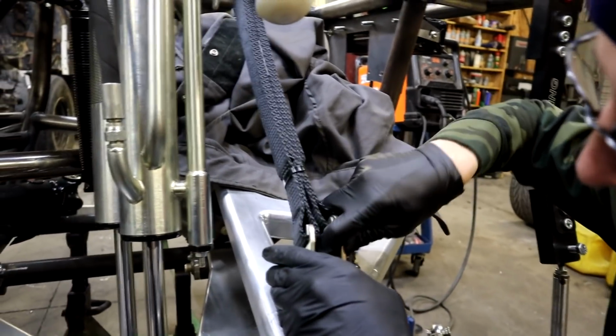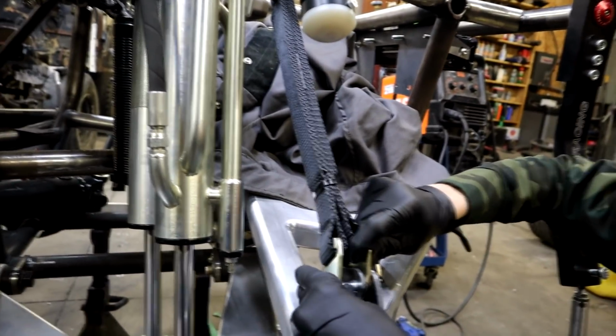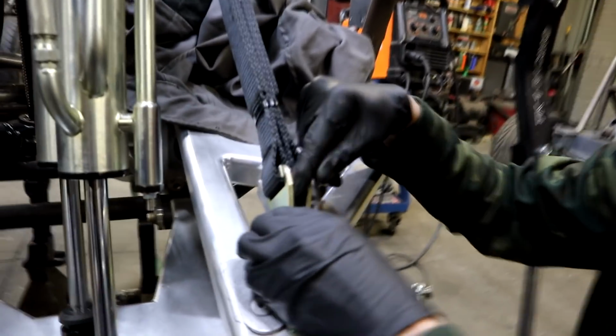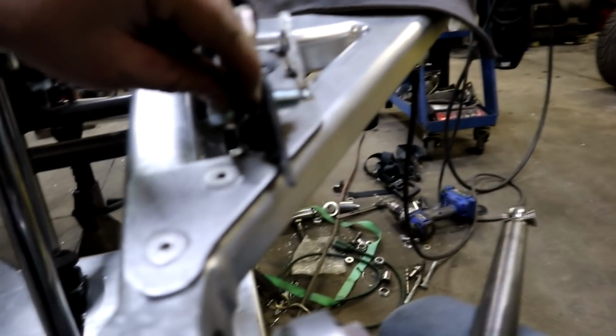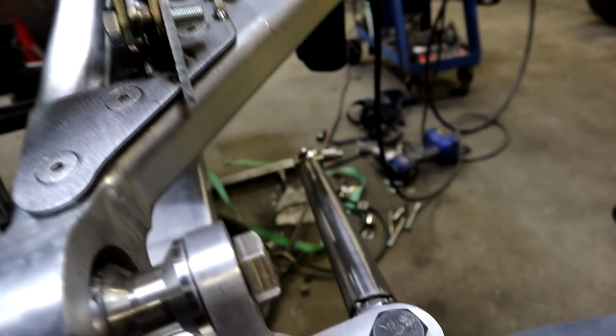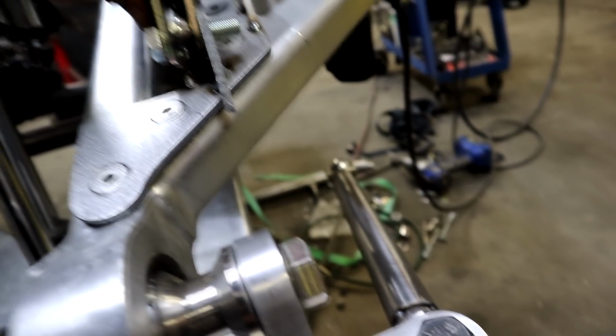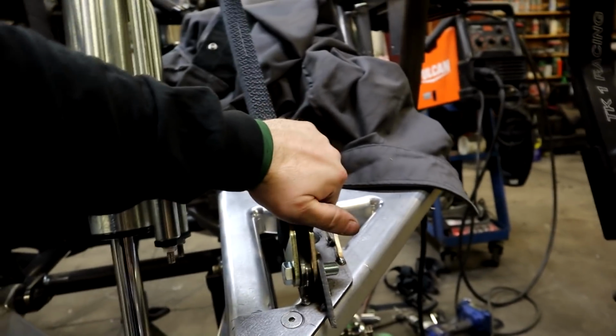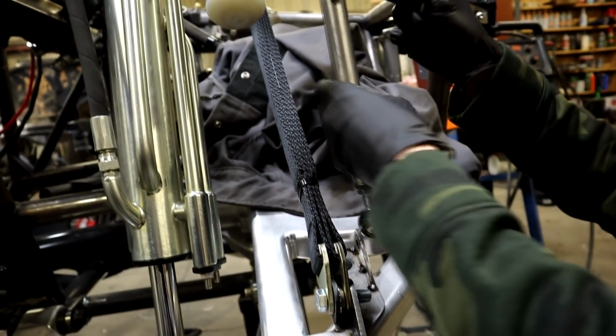So, we are using double limit straps, shortened the travel by 1 inch, and it works good. Good fit, too. And we use weld washers in here, as you can see. There'll be another one right here, and it spaces it out a little bit. Actually, we only need one. That's not bad. But so that, we got the sway bar in, and making some progress.